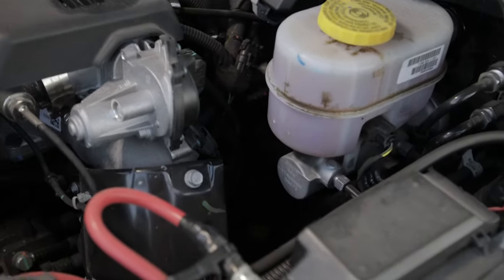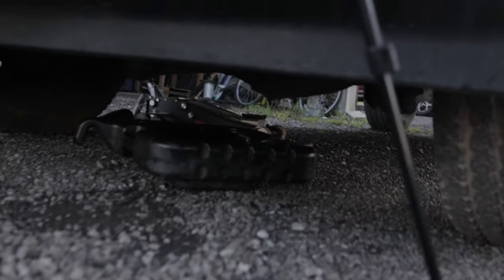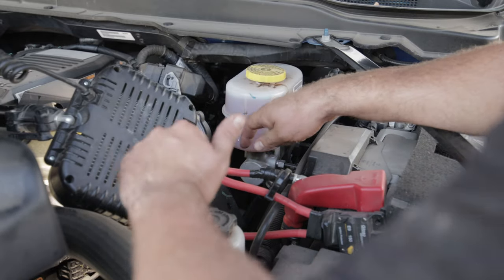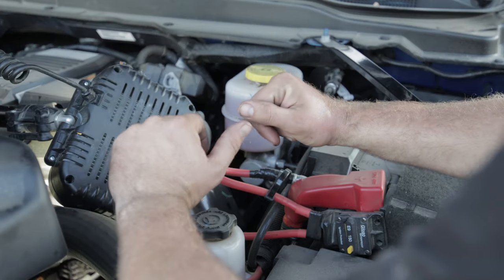We're on to the front fuel filter. This one's located underneath — there's your housing head, big plug directly below that. That is the drain screw. On the back side of that you'll see a rubber hose — it's clear, really hard to see — and from what I can tell it looks like it goes down and out just underneath the front diff. I did open the yellow drain valve, and where the fuel's draining is directly underneath the front diff. You'll see the arch in the diff — the fuel hits the diff, runs down, and goes right down the center. Put your drain pan under there and you're going to catch it.